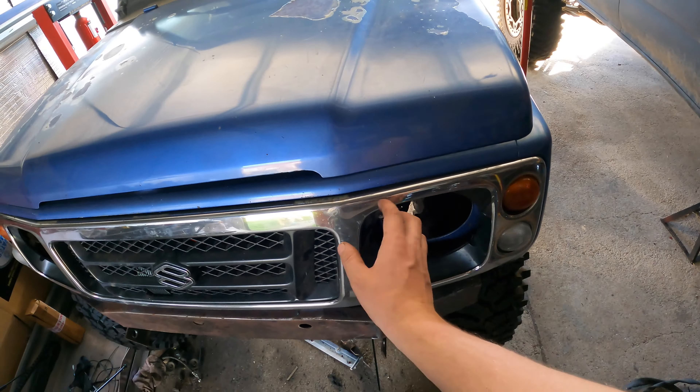What's tricky about pinching one of these front ends is that once you make all your cuts, they turn into a flimsy mess. It's a job that needs about six hands — if you have more than one person there's too much going on. I just prefer to tack this piece here, get it lined up, prop the bottom up. Get that bottom one lined up — they're the two you see the most. Then I'll centre it all up again and put a couple of tacks in here. That's obviously the trickiest part with the welding. I've had to trim out this bottom piece because of the front bar I've made — obviously made it to a different front clip and these are slightly different. I'm just going to slowly knock bits out of it until it sits where I want.